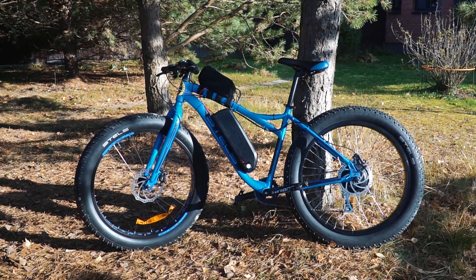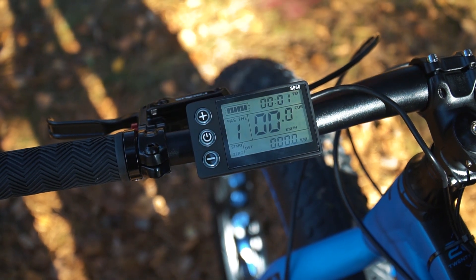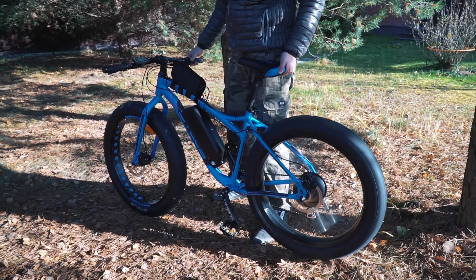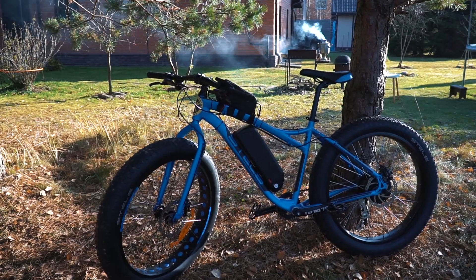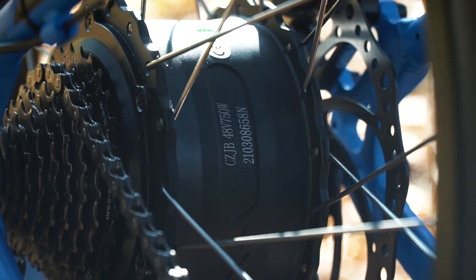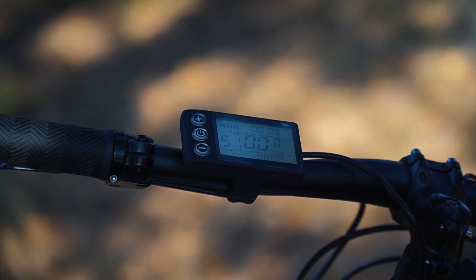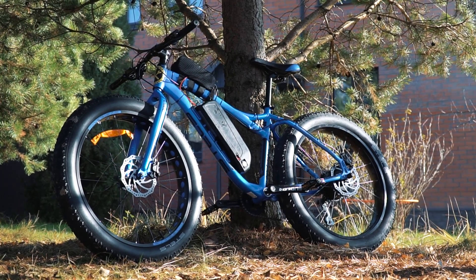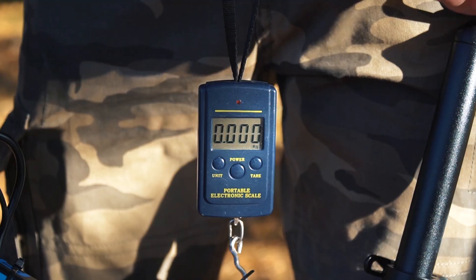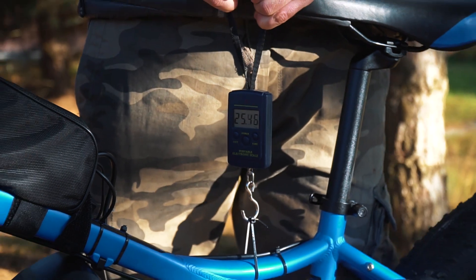Well, in general I think that's all. Our fat bike is now a real electric transport. Let's try to get it started — it seems we are ready to test it, but firstly let's sum up our work. As a result we've got the electric fat bike with aluminum frame, 26 inch wheels, hydraulic brakes, 750 watt motor, 14 Ah 48 volt battery, a decent computer and bright display, and finally perfect build quality. Let's make a final touch. As to the weight — it weighs 25 kilos, quite an appropriate weight for an electric fat bike. Let's have a ride!